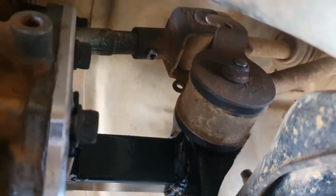Okay, so let's take a quick stock of where we are with the car. In the last few days I've got the gearbox brackets sorted out so that the shifter works properly now. Also got the rear diff brace in, which tied in the T-bar, the moustache bar, to the rear crossmember, so that's also sorted. Also got some welding done inside the car as well, just some seam welding around the seat crossmembers and a few other little bits and pieces that needed tidied up. There's a couple of welds that I wasn't happy with that got sorted out, so that's all done now.